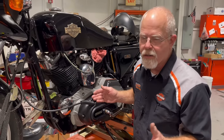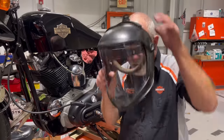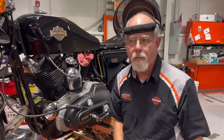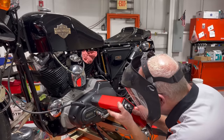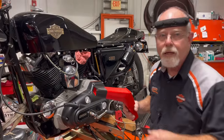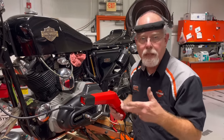Back in the early days when I started, I had an old technician with a shovel head. He took the plug out, walked over, got his mask on, and said, 'I want you to start the bike up and go to 2,000 RPM.' That's going to make a mess — oh yeah, that's going to make a mess. He would grab his timing light with his shield down, and a whole bunch of oil would start coming out, but he would look for that line. If he didn't see the line, he'd have me on the other side bump the timing forward or reverse until he found it. Then it was marked dynamically.